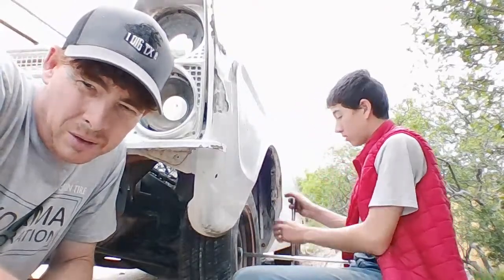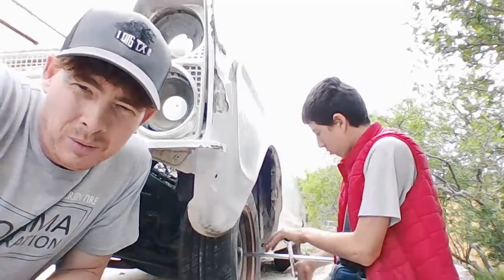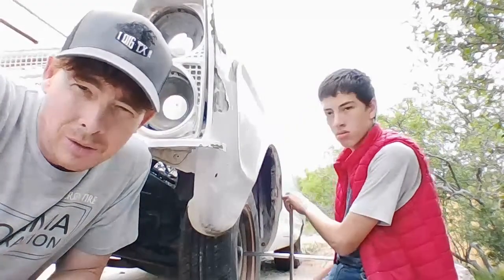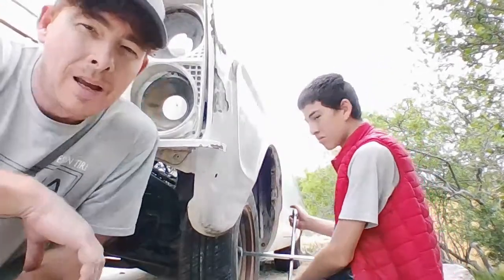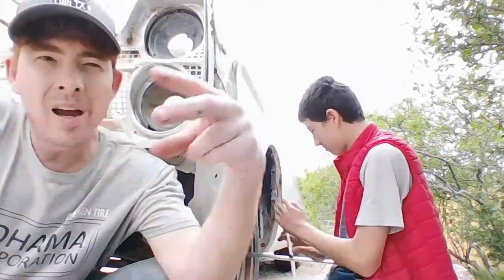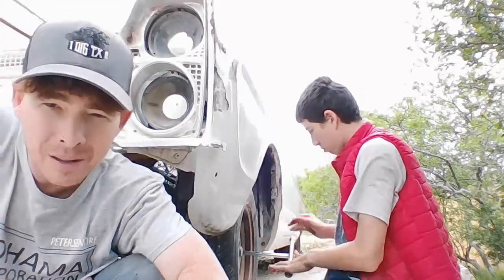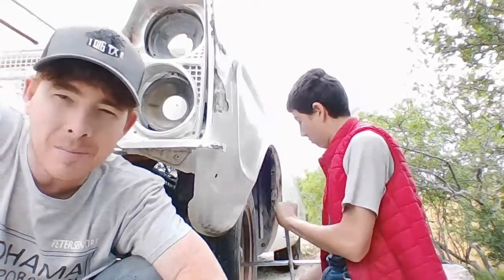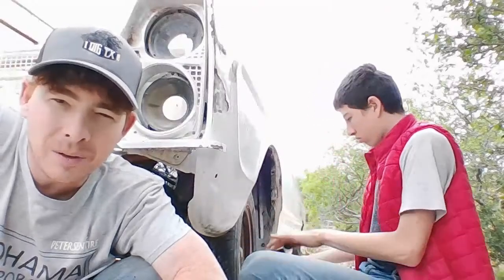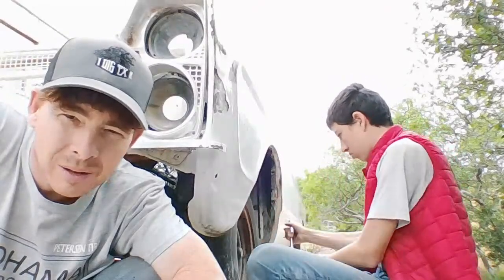245 first year, and one barrel, two barrel, or four barrel with 165 to 210 horsepower. Then a new small 215 and a big bore 3.91 inch 265 and two barrel, or triple 45 DCOE Weber six pack. Oh, wow. So the 45 millimeter DCOEs. I've got two 40 DCOEs sitting in Guatemala that I picked up. Okay, Jason, that kind of makes sense, the fact that you'd want them in a different direction. Rolling stock rules. Technical term is anti-clockwise.